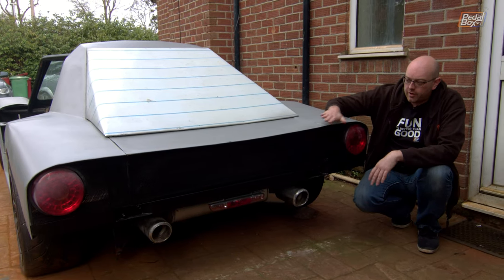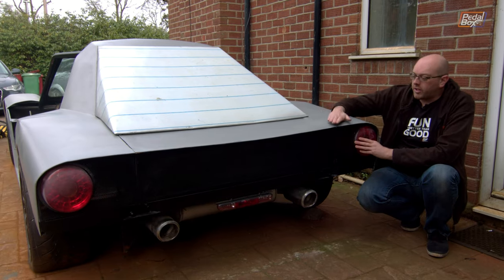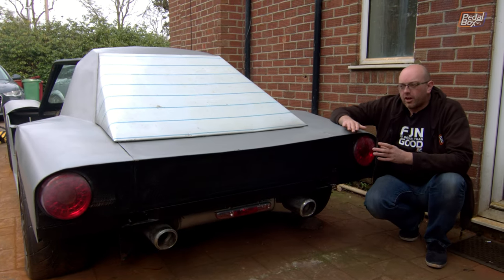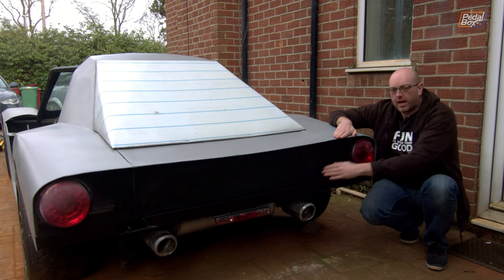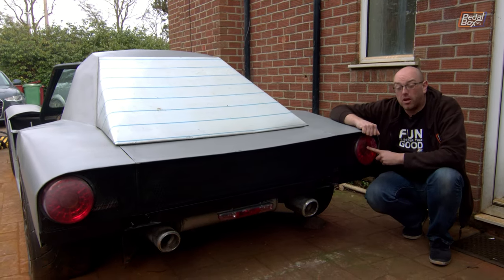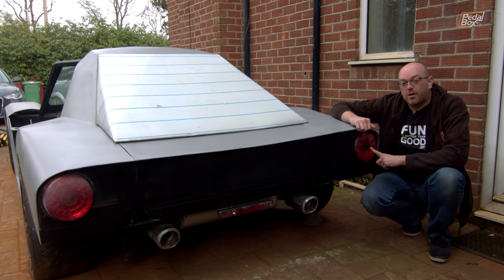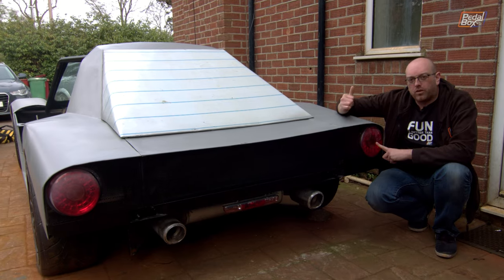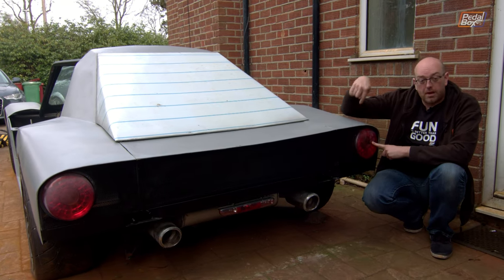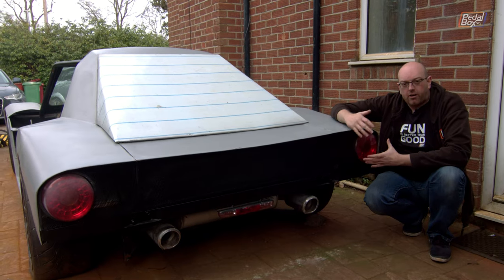Moving to the very back of the car — this design was in my head for a long time, though it went through changes while I was building it. Originally I was going for a Ferrari F40-style look with black mesh across the back, square edge, up, wing, down — would have looked really good. But then I found these taillights from an Alfa Romeo Mito after two or three months of searching. We cut down the original mounting plates, made our own mounts, and fitted them in. Having put them in, I thought it would look really nice if the bodywork just rolled over the top around the edge of the lights — so I sliced it off and put in a new piece of steel around the top, and I'm really pleased with how it came out.